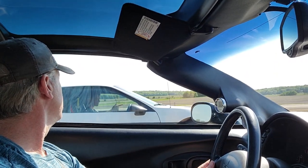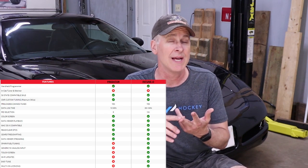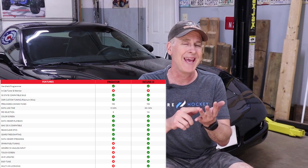For instance, maybe you want to lower your fan temps just a little for daily driving, or lower them more if you're heading to the track, and you can always change the fan settings back to stock. These handheld offerings can do quite a bit more than just change your cooling fan on and off temps — you can data log, read and clear diagnostic trouble codes, install canned tunes for higher octane fuels, change your automatic transmission shift points, and increase your maximum RPM limiter.